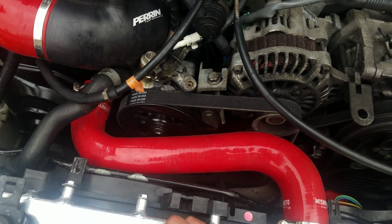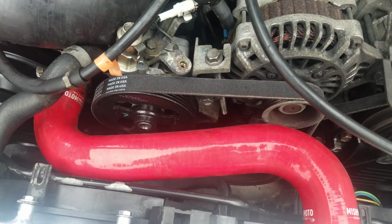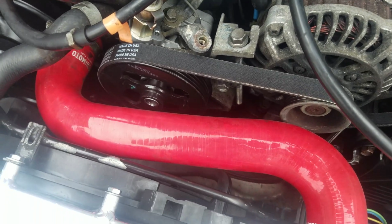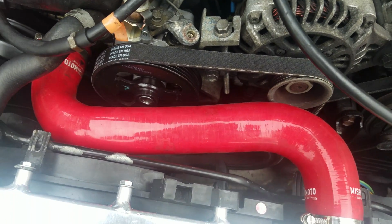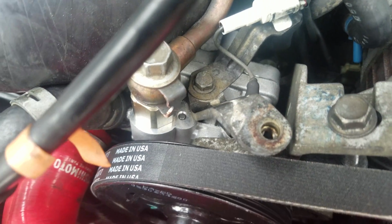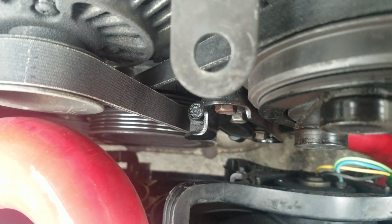So here's the thing. I figured out I put the hole on right, I drew the arrow, but it was already too late. The thing was screwed. It wasn't leaking fluid from the reservoir anymore, not from the top right there. It was leaking from the bottom of this big square block, the actual power steering pump, all down there, burning up like crazy, smelling, my car smoking like crazy before I even got up.